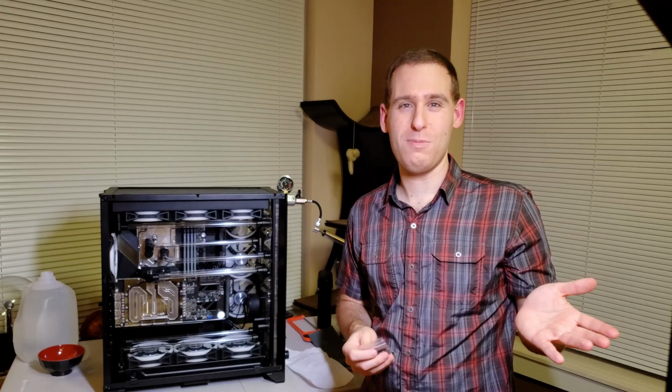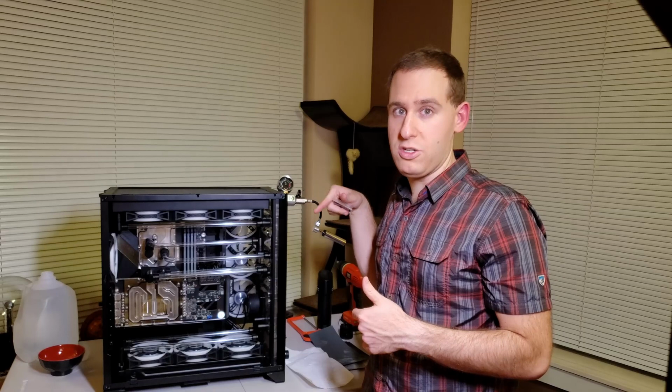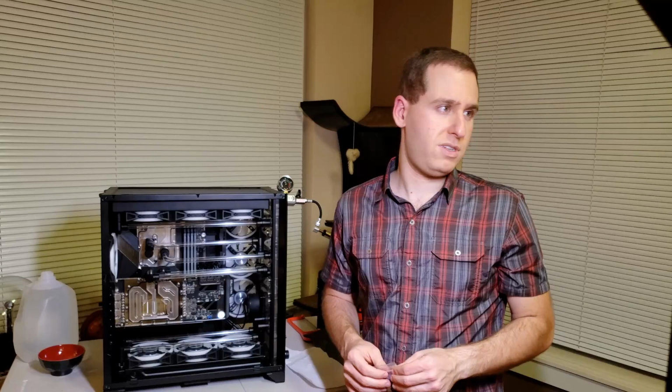This leak tester seems to be used by everybody in the water cooling world, as far as I could tell, on YouTube and whatnot. And like some others that have commented on its use on YouTube, do not be fooled by the green and red icons on there. That has nothing to do with how much you should be pumping up your loop to. Do not pump it up into the green or the red just because you see that on there. Read the manual. It says 0.3 plus or minus, I think, 0.05, and leave it there for at least 10 or 15 minutes, something like that.